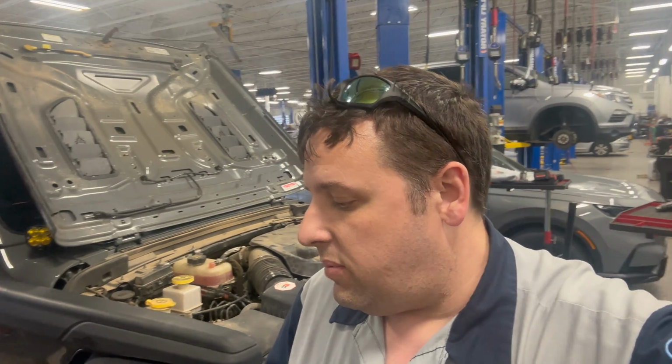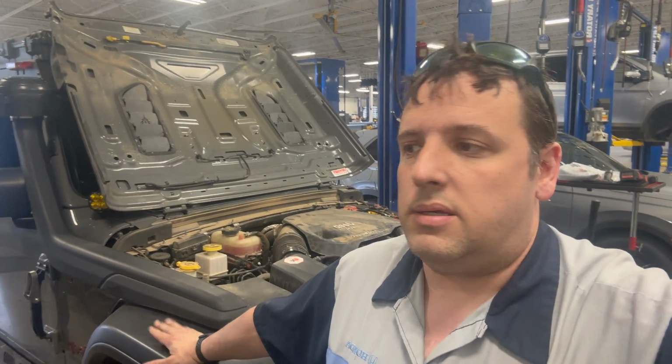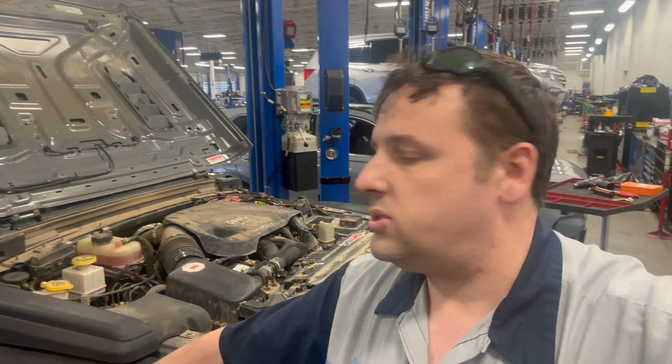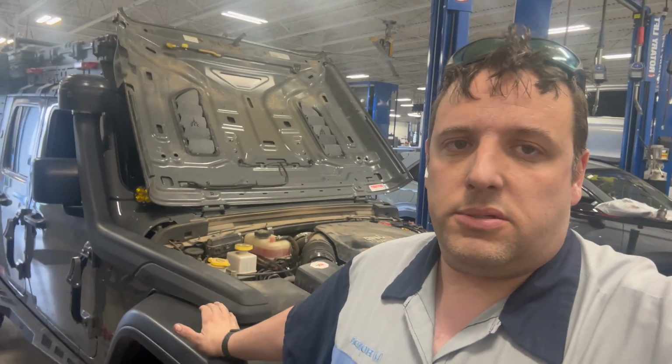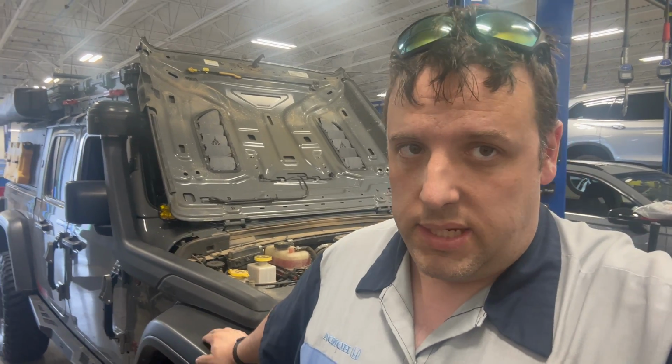Now, I do have a trusted friend whose workmanship I've seen, and I'm going to have him do the regear because that's what he does for a living. So definitely post a review on that. We're going to 4.56 gears on the EcoDiesel Gladiator, and I believe that's a strong modification we need to do, and we're at that point. So we did get Dana Spicer gears with the master rebuild kit, which includes the shims, the oil seals, and the bearings that you need when you press all that stuff out. We're going to do 4.56 gears, which is what AEV recommends with their EcoDiesels on 37s. They recommend the 4.56 Dana Spicer gears.